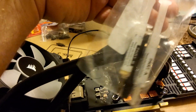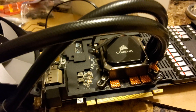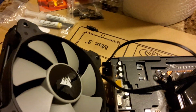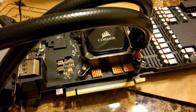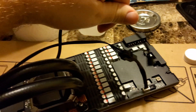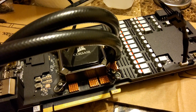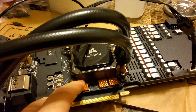If the heat sinks fall off I've got Arctic Silver Part A/Part B — it's like a paste you mix and then it's more like a cement. One nice thing I found — I forgot I had it — is this old adapter that converts the fan header on the GPU to a four-pin for the water cooling radiator fan. So I can control the fan speed with GPU software instead of through the BIOS. The pump from the Corsair I'll just plug into the motherboard to make sure it gets the power it needs.